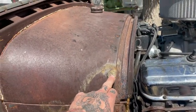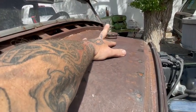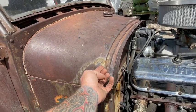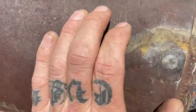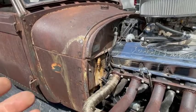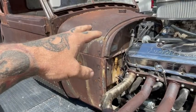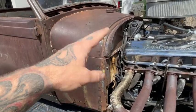Here's where the tank is leaking. On these old guys, I can't quite reach it, but that is where you fill it, and from here up is your gas tank. He tried some of that gas tank fixer-upper putty or JB Weld or something — it's just that little hole right there. Here's our petcock coming up the bottom. The bad part about these, unlike a normal tank, is you can't take it off and shake it up to get it cleaned pretty good. So we're going to drain it, fill it with water, drain it — probably do that a couple of times.